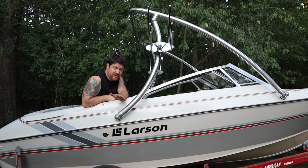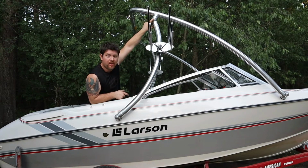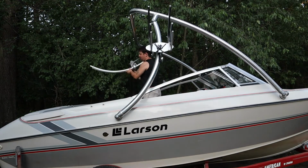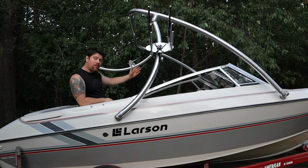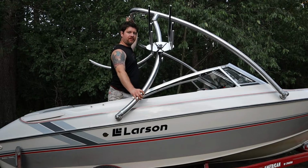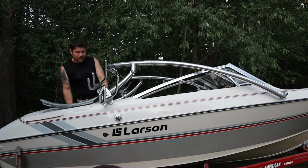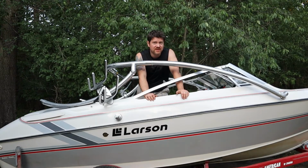Now, if you're alone, this can get tricky, but I have a workaround if you're alone. What I do is I leave one side of the upper bolt very snug so that it can't move easily, and you'll see what I'm talking about here. I go to the side that's snug yet, lift up. Now if you left it snug, that arm will hang in the air like so. Then you can come over to this side, grab your tow bar portion, pick up, and bring it down like so. Now, if you've installed it right, this should get almost as low as your windshield.